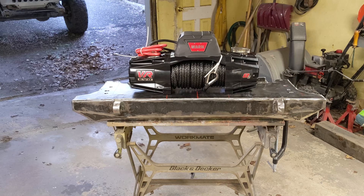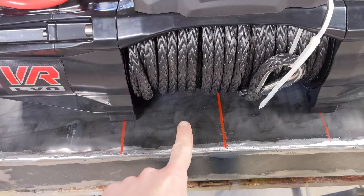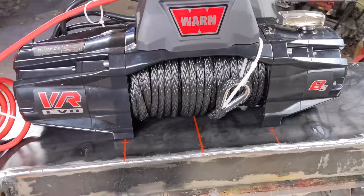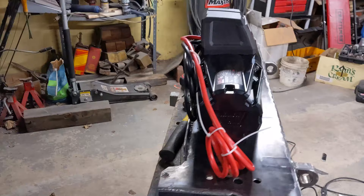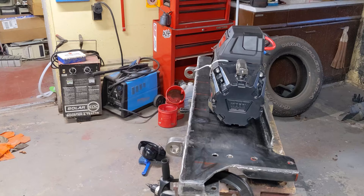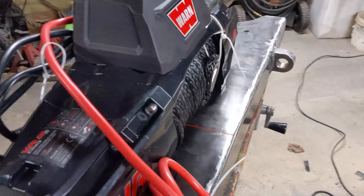The next thing I want to do is drill for the holes to mount it. I'm thinking about how far back from the front it wants to sit — I need room for the guard in front. I'll mark and go four and a half inches back on each side and mark again for the hole locations. I drilled two holes and they lined up perfectly — didn't have to widen or file them. I'm apparently getting better at this. After drilling all four holes, they all match up. It's amazing. I wanted the winch sitting as far back as possible to leave enough room for the guard, and maybe someday when I have a tube bender, I'll make some kind of a hoop.